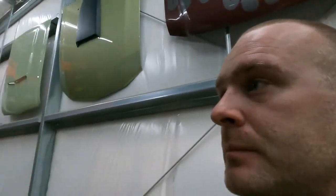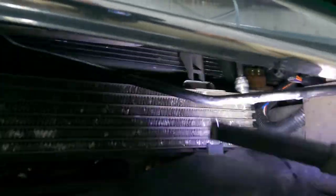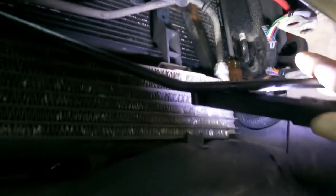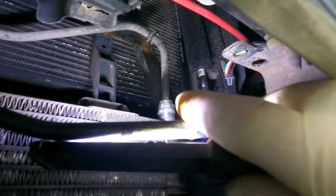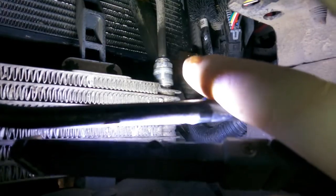We got the lines routed all the way up to the front of the truck and I cut the two old factory lines in the rubber section, so I've got the back side out. Now we're working on the front. If you look up in here, you have the transmission cooler right here — one line going in on the passenger side and one line on the driver's side right up there. There is a small black plastic clip right here above my finger that was just slid down over this. There's a little notch in the top, and inside that notch is a very small snap ring.